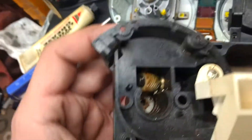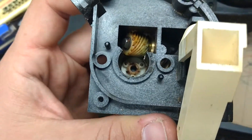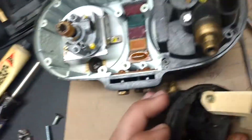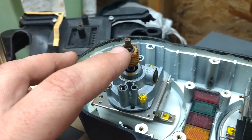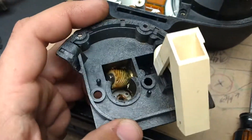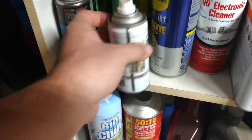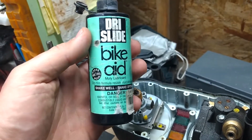A couple of things to note in here: deep down you'll see a small white plastic part held in by three flathead screws in the back — that's a carrier, kind of like a spindle guide. The top of the metal spindle I would also clean off and lubricate with white lithium grease, and lubricate both worm gears. I'd also be tempted to drop in something like Boeshield T9, or this stuff from the bicycling industry which is basically similar to graphite lubricant.